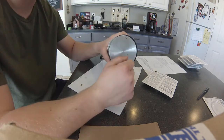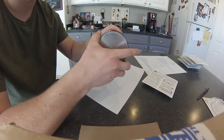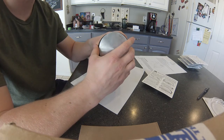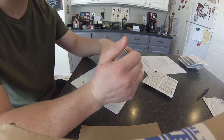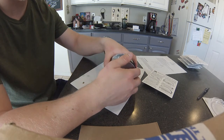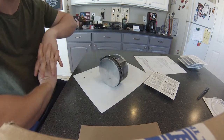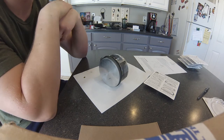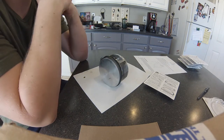Also have someone double-check to make sure all of your middle rings are facing the correct direction as well. That's it for piston rings. We've already checked the clearances on them, put them inside the cylinder walls, and checked our end gaps — they were all really good. We've honed the cylinders, cleaned them, and all the journal bearings are clean. So these are actually ready to go back in now.